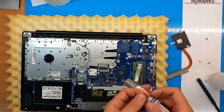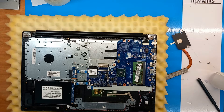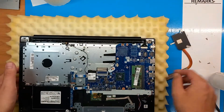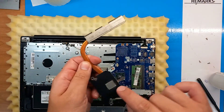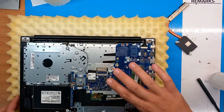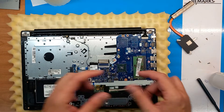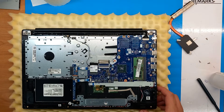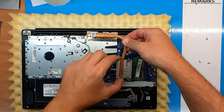Thermal paste time. The best way is just to make a small grain of thermal paste in the middle of the CPU. This is more than enough — you can put even less. Once we assemble the heat pipe with the cooling plate, the paste will spread around the square and cover the whole surface of the CPU. There are no special techniques. For laptop CPUs which are small, just a grain-size, very small bit of thermal paste in the middle of the CPU, and that's a job well done.